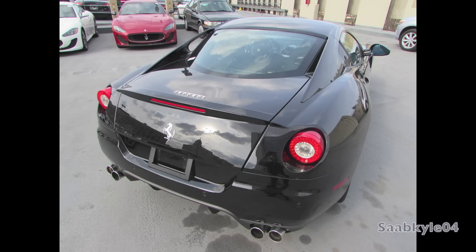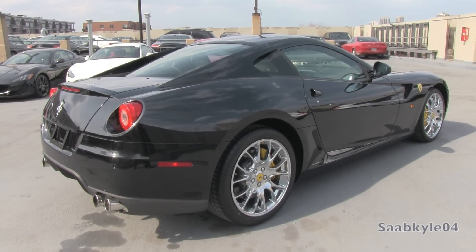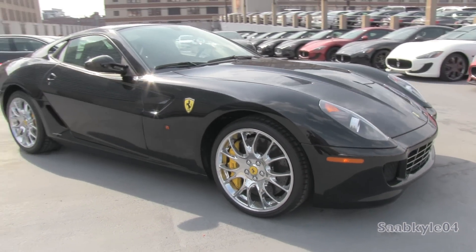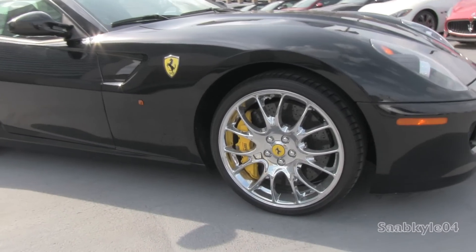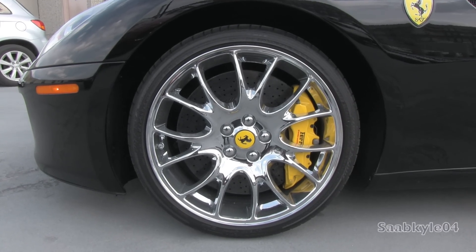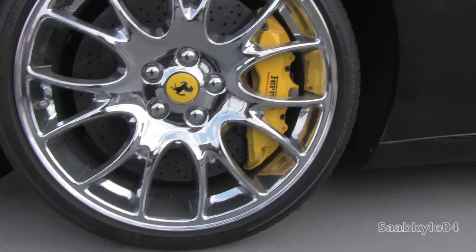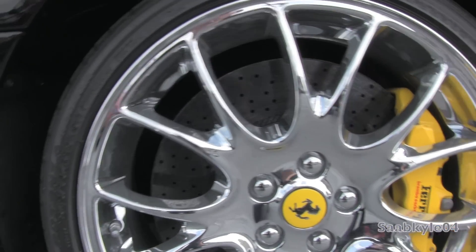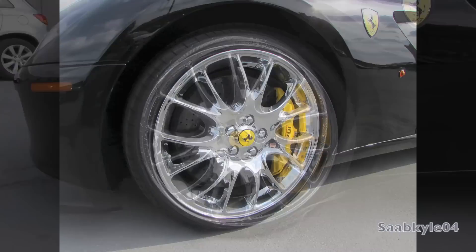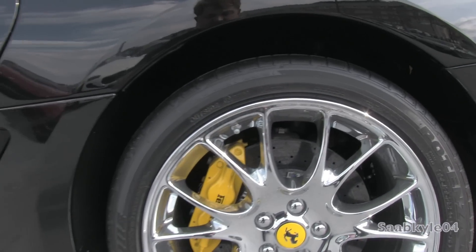The flat underbody and venturi tunnels create a suction effect underneath. Paired with the rear diffuser, this helps draw the car toward the ground at speed, producing a net downforce of 154 pounds at 124 mph, 352 pounds at 186 mph, and 418 pounds at top speed. This 599 comes with optional challenge-style staggered cast aluminum wheels measuring 20x8 inches in front and 20x11 inches in the rear — the first 20-inch wheels ever offered on a Ferrari road car. The custom Pirelli PZero tires, formulated specifically for this vehicle, measure 245/35s in front and 305/35s in the rear, and have been tested to pull upwards of 1G in lateral cornering forces.